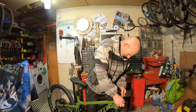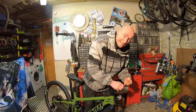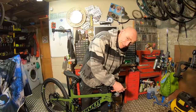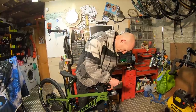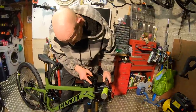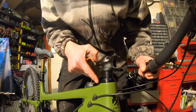I've got to watch me fight with a stem bolt because somebody's decided to tighten the bars up tighter than necessary — a real pet peeve. You don't need to tighten the stem clamp once the bar is out. Going back to details: it's Pivot's own stem, a really nice-looking cold-forged unit at 45mm length on every size except extra small, which gets a 35mm length.